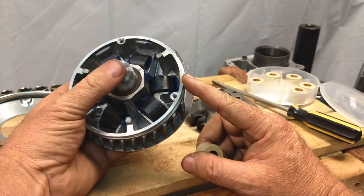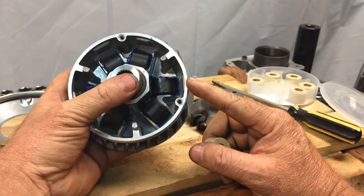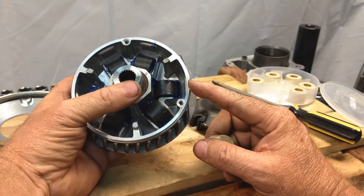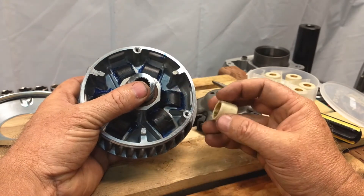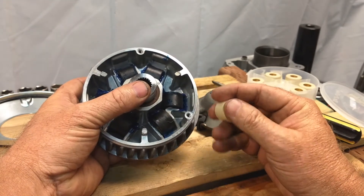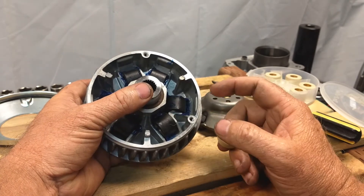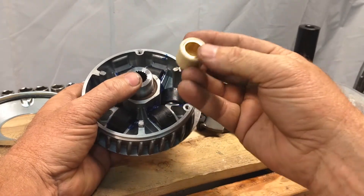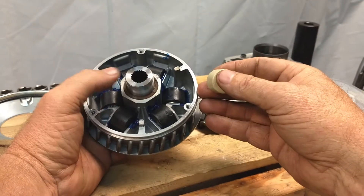These things are designed for each engine, each application, each gear ratio — so you can't just pull weights out of a scooter and hope they'll work. You want to make sure you do the math right. By going to a heavier variator weight, say 24 grams, it may take a moment to rev up through the gear ratio range, but it'll maintain your top end speed. A lot of builds will go to lighter variator weights and pair them with heavier torque springs and clutch springs.